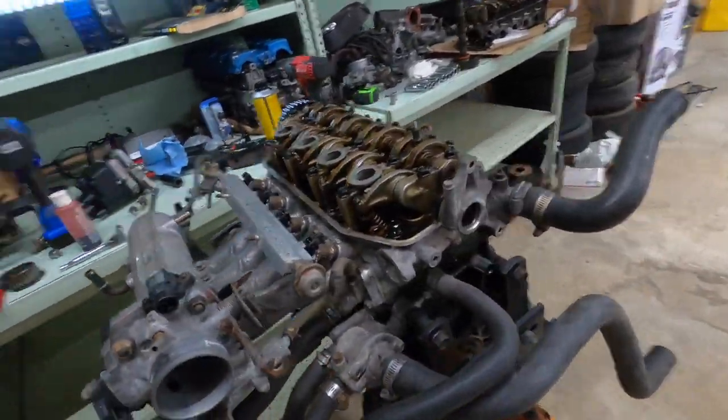That's really all we're gonna get to do tonight because I need to get my torque wrench so I can torque these down. Then we need to time it and then do the valve adjustment because this cam is not meant for these rockers. So we have to go in and adjust the valve lash so that it's accurate and it's going to be on time.